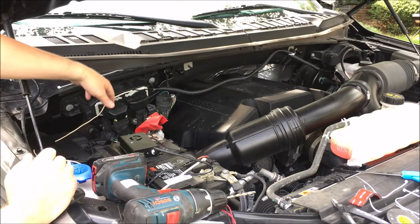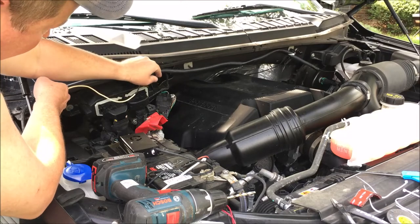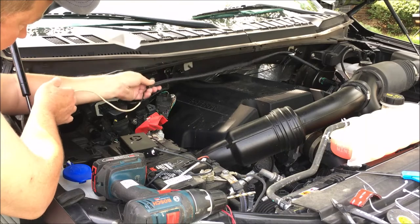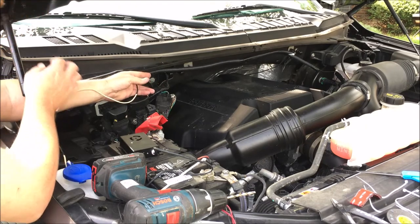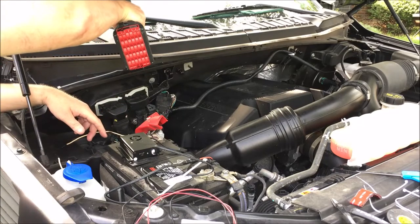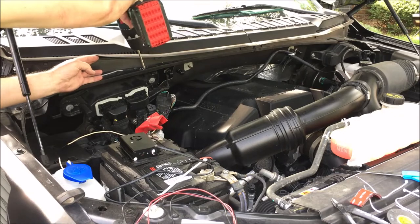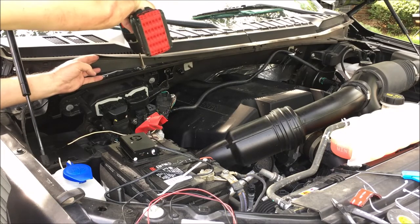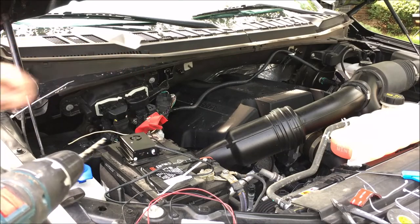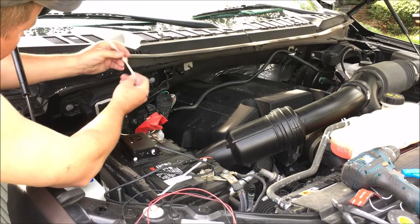I've got my LED wire extension done and I put the wire through some automotive plastic shroud to protect it when it crosses over the engine. I found a nice tie spot on the far side on the driver's side, but over here there really isn't anything. So what I'm going to do is drill a little hole in the top of the cowling — it won't show when the hood's down, but it'll give me a nice zip tie point. I cut through a little bit of aluminum there, which is fine — even a stronger tie point.